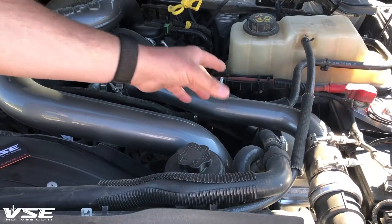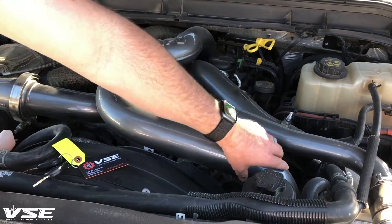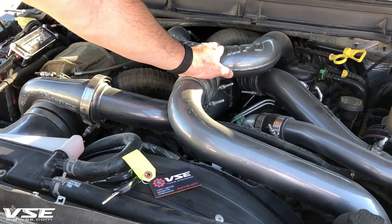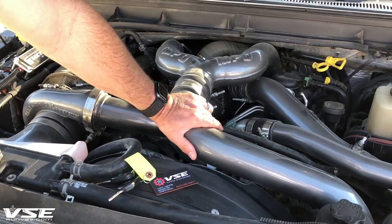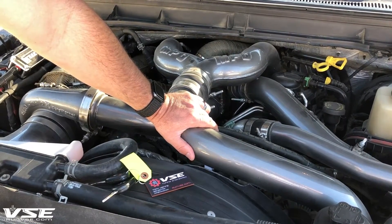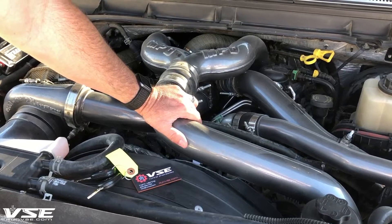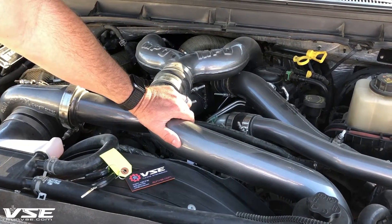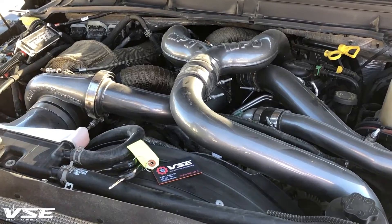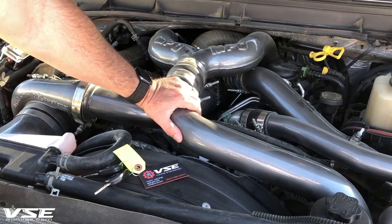This is a factory Ford-style intercooler, but No Limit Fabrication has supplied us with a better heat exchanger. The air comes out of the heat exchanger and is fed right into each head pipe through a modified Y-bridge. We end up at about 630 grams per second of airflow at about 130 degrees at full load, versus being maxed out on a 2015 turbo by itself at about 400 grams per second and about 200 degrees. We're at higher boost pressure but cooler temperature because we're compressing the air less using a big turbo to feed a small turbo.